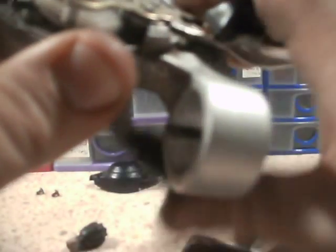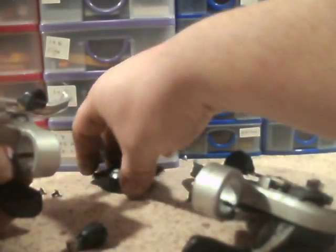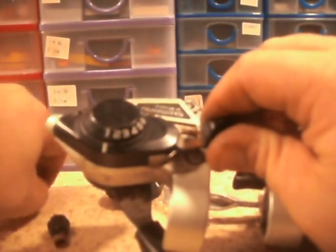So we'll try again. One, two, three, four, five, six, seven. Well, it's working now, it seems. I wonder if it'll work when I put the cover back on. It's all the way up so it's in first. I'll just rotate this to first, which actually looks like a smaller number seven. I don't know what Shimano were thinking when they done these letters. So we've done this one. All it was, was that little hammer thing was not catching on the teeth of the mechanism properly. Maybe me bending it in with the screwdriver probably helped it — it may have just got from general wear and tear bent out, or maybe the teeth were worn.